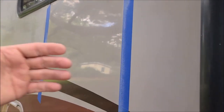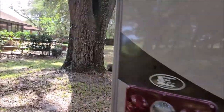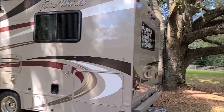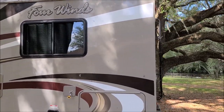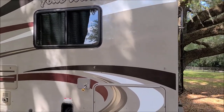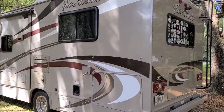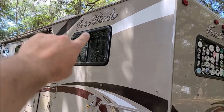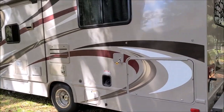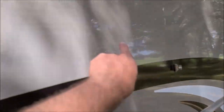After I cleaned the glue off and then compounded, that's what's left. I am going to have to polish this whole thing, mostly because it does have some buffer trails from the rotary. So I'm going to go at it with my universal all-in-one, then I'll be putting on my gel coat ceramic acrylic pro hybrid coating. That lasts three years in a saltwater environment — should get a little bit more than that on an RV if it's covered and out of the sun most of the time. You can see the definitive line between the section I did and the section I didn't — that's the tape line. No doubt that this looks better than that, and you can see that glue right there.